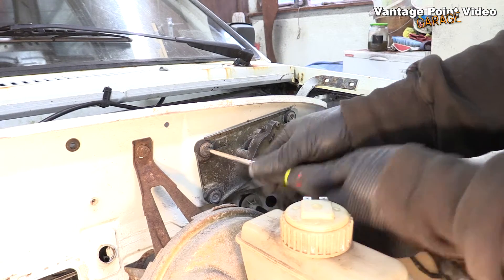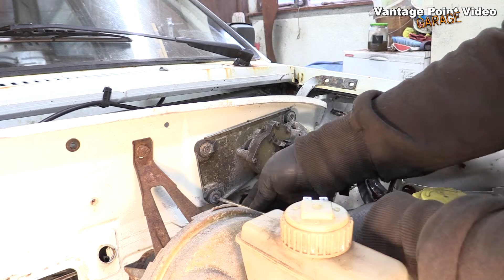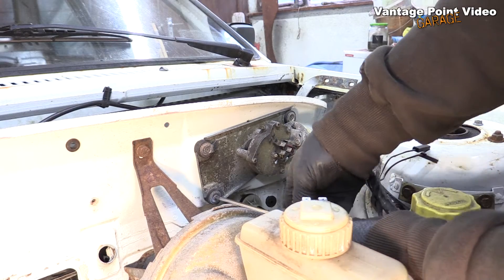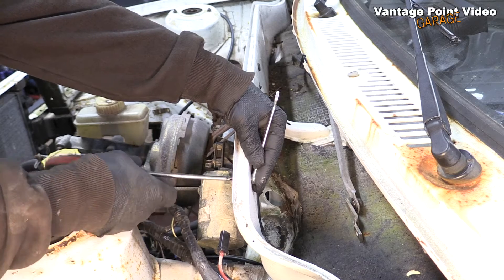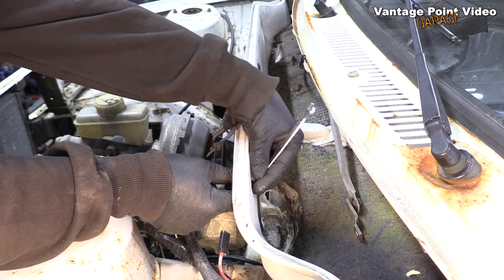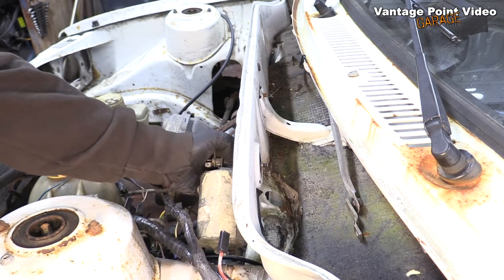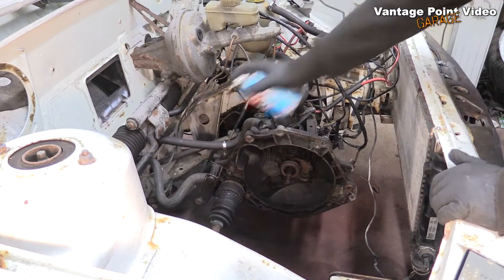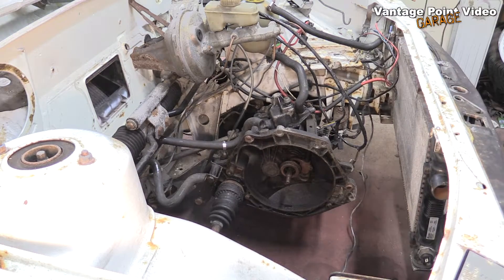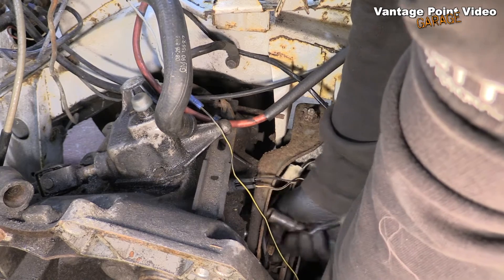It's a nicer installation on the left-hand drive cars. The wiper motor is actually inside that scuttle panel and the base of it sits often in water and can get very rusty. These are a couple of the things that make me glad I'm building one of these cars in their true original design form — the main reason being the location of that brake master cylinder. I'll just put a bit of penetrating oil on those two pipes in and out of the interior radiator and loosen them off later.